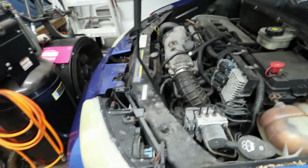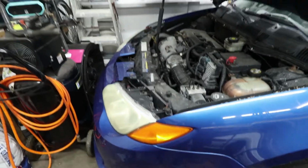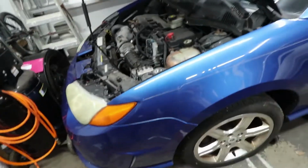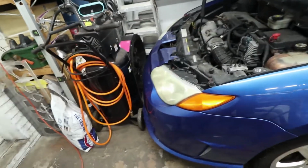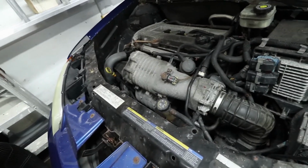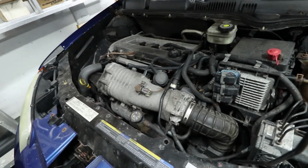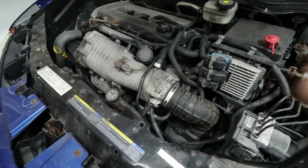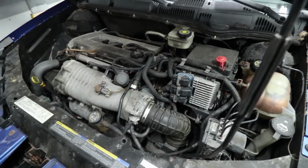It has oil in the coolant. I'm being optimistic because there's no coolant in the oil, although there's no oil in it because it dumped all the oil into the coolant system, or the majority of it anyways. But I'm being optimistic that it's not a head gasket because this has actually happened once before. On these cars, there is a water to oil cooler that's factory installed. It comes from the factory. It's an oil cooler that uses the car's cooling system to cool the oil.